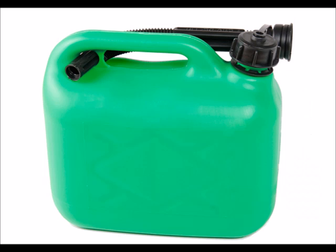And stale fuel, by the way, is an odd one for me. In the past, I've used stale fuel and it's caused bog down in my machines. And on other occasions, I've used stale fuel and it's caused flooding. So that's why I've put that down as a cause for bog down, because in the past it has caused that for me. And I just attribute the reasons for that as because there's less combustion ability of the fuel, if you like, because its goodness has evaporated away and left behind that gum.